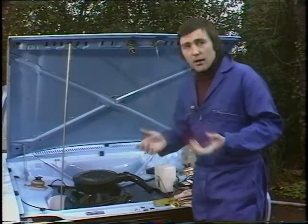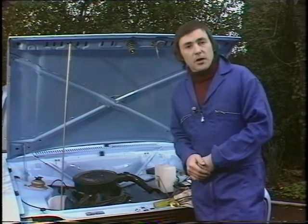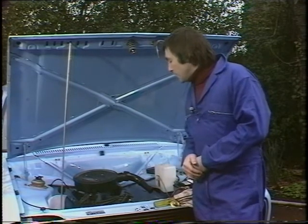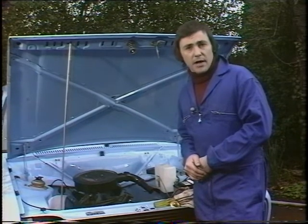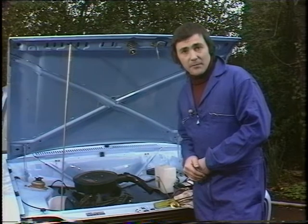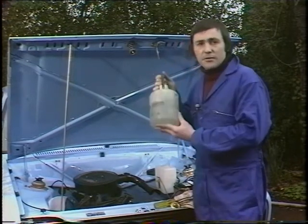So to recap: you're driving along and the engine is overheating — what do you do? Check the level of coolant; if it's low, top it up. Then check all the obvious things: is there a leak at the hose clips or somewhere in the hoses themselves? Is the fan belt still there, and if it is, is it at the right tension? Is the thermostat working properly, or is the water pump up the creek? And talking of creeks, there may not be one near you — so do take your own supply of water.